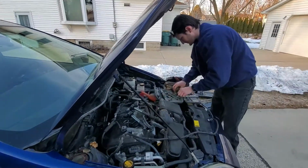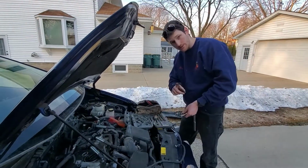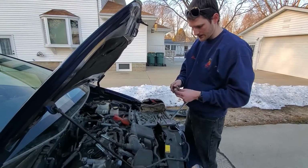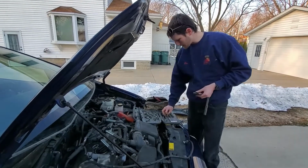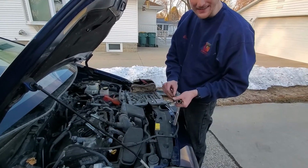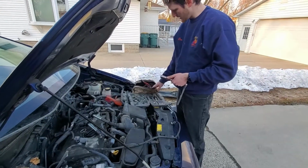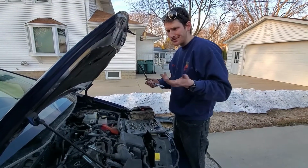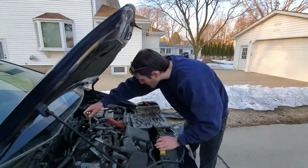Now I gotta get to our spark plugs. So here's the little nifty trick I got here. You take off your 10 mil, don't lose your 10 mil. So the tool I got is a basic 16 millimeter socket, which gets pretty much all your most modern spark plugs out, you know. And I got a little magnet here, see? And once I undo them, I use this magnet to pull the spark plug out. You know? And I never lose the magnet because it's a magnet. So if I put it in my fancy makeup bag here with my tools, always steal your girlfriend's makeup bags because they're useless anyways. I don't know what they are for, you know? You do that and you'll never lose it because the magnet will go on something. Always does.